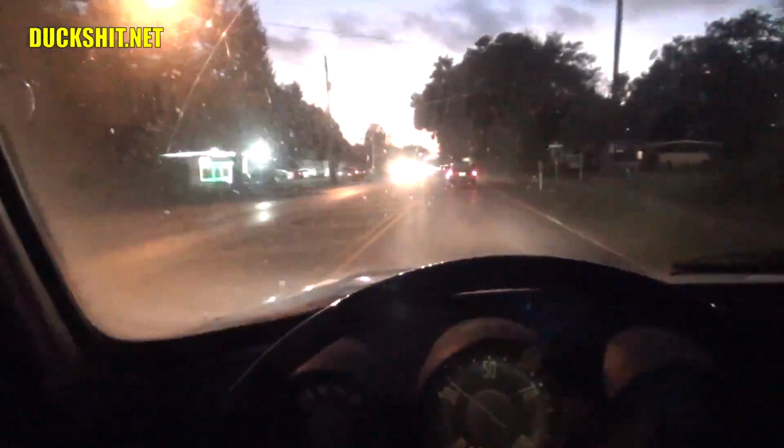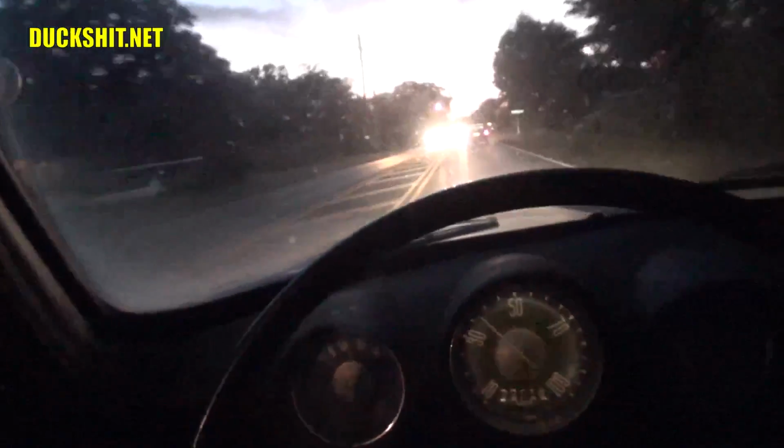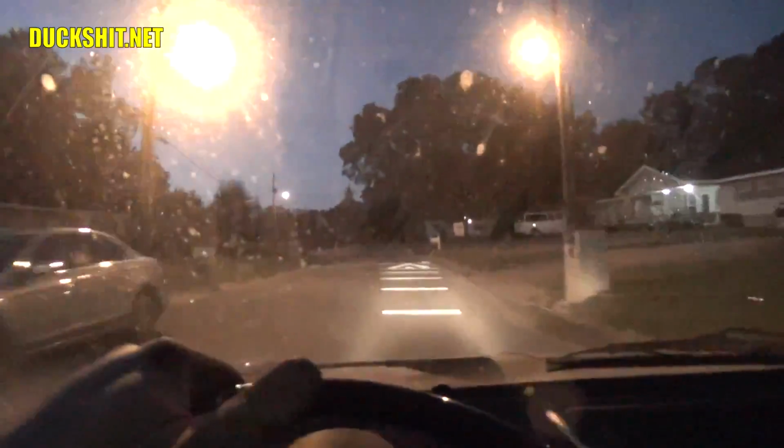But it's working good. I mean, even at small throttle positions, it's smooth, which tells me that the carburetors are very well balanced right now. So if they stay that way, then that means the throttle linkage is exactly what I was looking for. Wow. I gotta admit, this thing is driving nice. It's driving really nice.